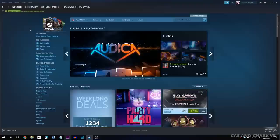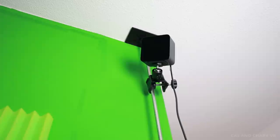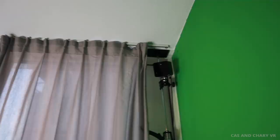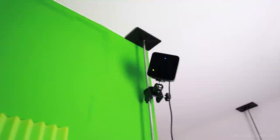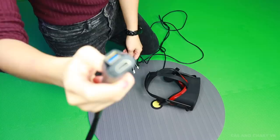The first step is to download and install Steam if you haven't yet — I'll link Steam in the description. The next step is to get your SteamVR setup ready, so you need to connect your base stations. They do not need to be connected to your PC in any way; they simply need to be plugged into an electrical socket. We recommend placing them in opposite corners of your room, placed high up facing down, and they have to be able to see each other. Then one of them needs to be on channel B and one on channel C — press the button on the back to cycle through the channels. Once the light at the top of the base stations turns green, you are ready to move on.